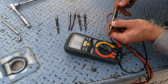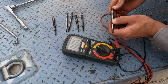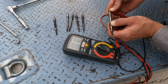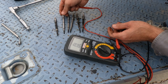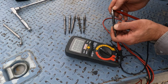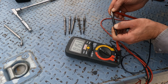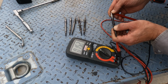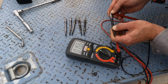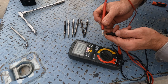The meter also has a lead resistance offset I'll show you — these are not actually reading a true 1.1 or 1.0 because of the meter leads themselves, and I'll explain that in a second. This is the last one: number six — the other plug we had a fault light for. This one is way out of line, way too high. I've seen these come back at 100 or 150 ohms, so this one is bad — but I've seen worse.